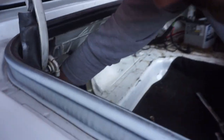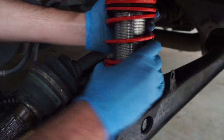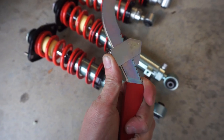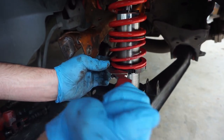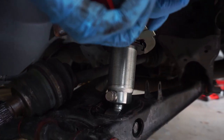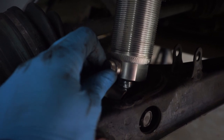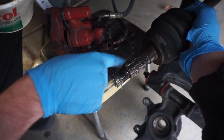So we get it lined up in place. Alex starts the top two nuts, and once those are started we can begin to assemble the suspension again. With everything in place we can begin setting our spring height, first by hand and then using an adjustable wrench. This spanner helps us spin the bottom and get us close to Flying Miata's recommendation of five inches between the bottom of these rings and the center of the bottom bolt that goes through the coilover. If you look here you can see the damping adjuster — it's just one-way adjustable, but that's still pretty nice to be able to adjust your damping.